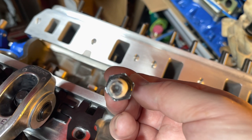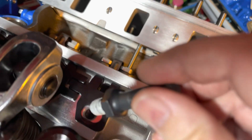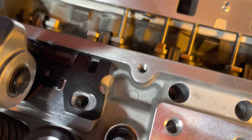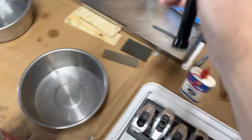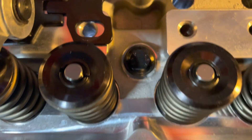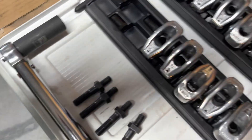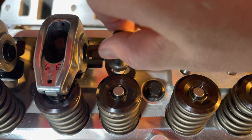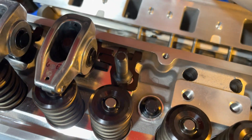I put some oil around the head of my bolt and some thread seal — doesn't need very much because there's not a lot of clearance between the bolt and the thread, and it just pushes out all over the place if you put a lot on. You can see down there where it goes into the intake port. So I screw this in and then try to line it up as best I can, moving back and forth between my wrench and the torque wrench because it tends to move a lot while you're tightening it down.